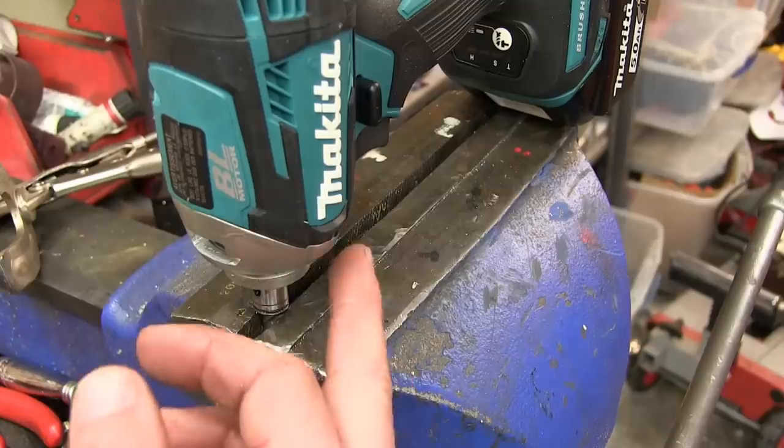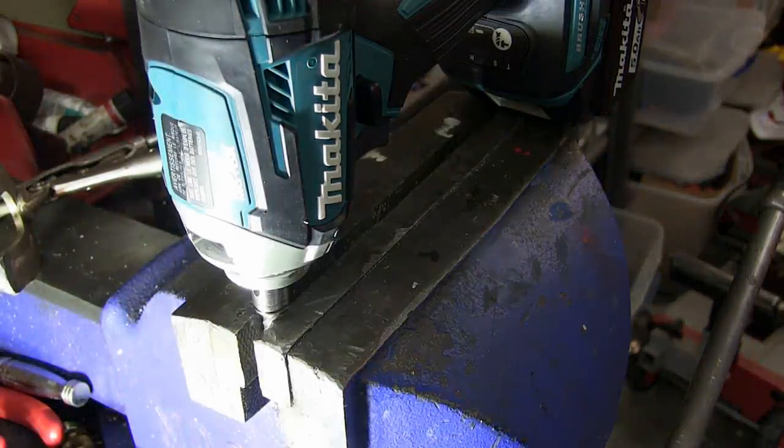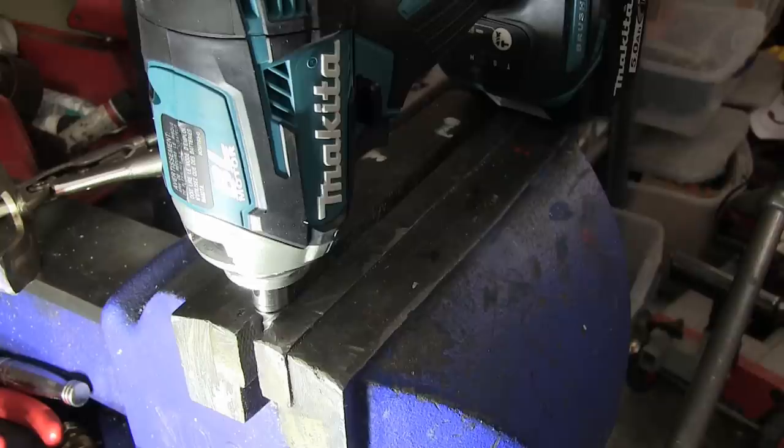Yeah, I don't know. Okay, we'll get the high-speed camera set up. Looking at this, we'll get the studio lighting going. There we go, blinding. And we'll see what's going on there in high speed. Oh yeah, that's really cool. That's the potato vision here. High speed potato vision blurrily illustrates the thing is not mass tuned. It's harmonically not hitting as hard as it could, because you see the hammer is coming down and it's bouncing. And sometimes it bounces twice on the anvil with a second little hit. It doesn't clear it all the way. Very interesting. And you see here when we're going full speed, it's almost on a diagonal. Like it's, yeah, pretty neat.